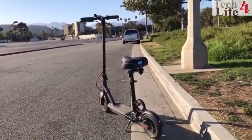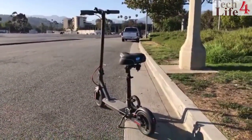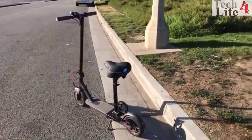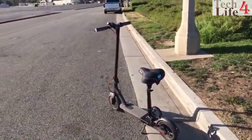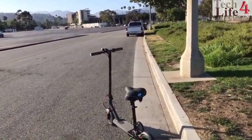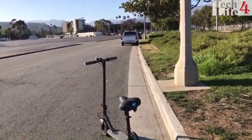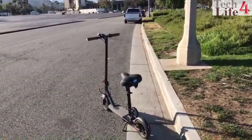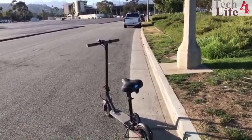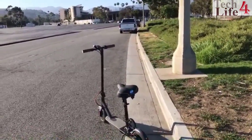There's a woman who crossed the country with solar panels. She had 240 watts worth of solar panels and an electric bike. She used a Schwinn electric bike with a 250 watt motor, and she had 240 watts being produced by her SunPower solar panels. She also used 2 Genasun maximum power point tracking boost chargers, and the solar panels hooked into those chargers, and the chargers hooked into her battery.